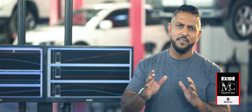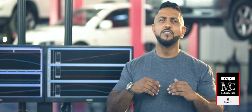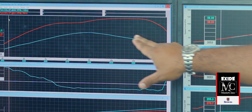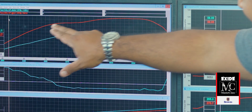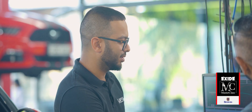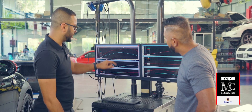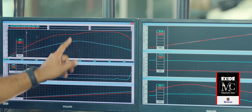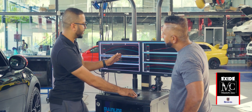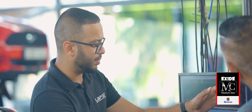Sabri has done another run on the Mini Cooper and reflashed the ECU and got a little bit more power. The blue line was what we ran first. Is the red line what you got now? Yes. Wow — some really impressive gain. We've made a lot more power as you can see, right at the red line as well. We've shifted the peak power from about 5,000 RPM all the way up to about 6,400.